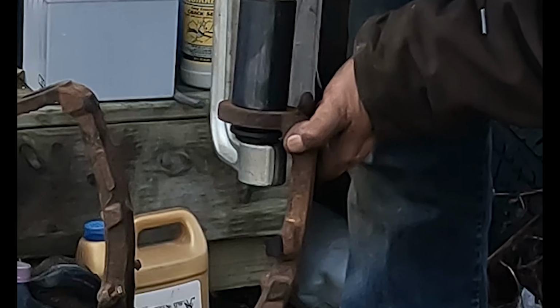Right. Have the wrong size Allen wrench. I'll be back. Something you can do too, if it doesn't work, is you can pop this joint off and then grab the ball with a pair of vice grips. That will also work. You can take a die grinder and cut the bolt off. So you have other options if you can't get it off the quote unquote proper way. Alright, so couldn't find the proper size Allen wrench. So I opted for the die grinder.